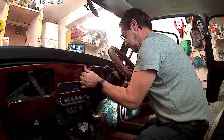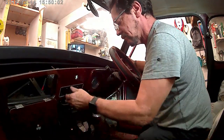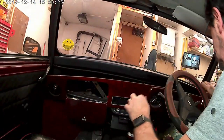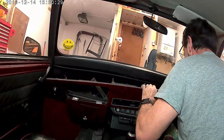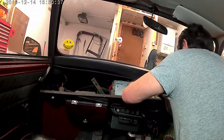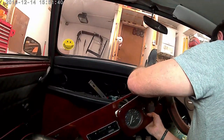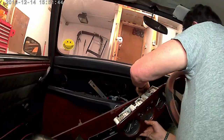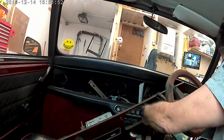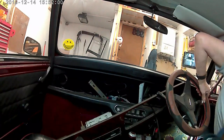That's the last wing nut. Now this is a little dash binnacle but obviously we've got the cables and the speedo cables still connected. The speedo cable is just getting trapped by the grommet on the firewall so I'll just go and release the grommet and let it come from inside the engine bay.